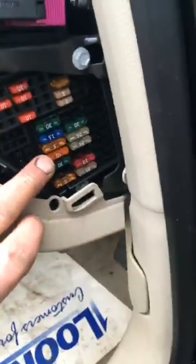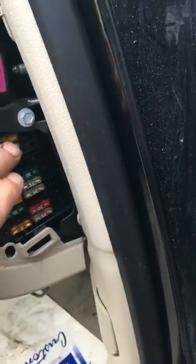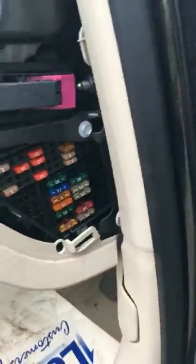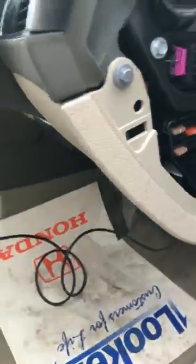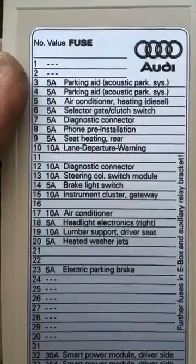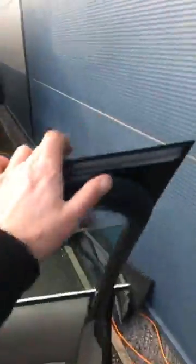I thought, let's check the fuses. I'd already checked the 40-amp fuse down here for the blower motor and that's fine. Going through the other fuses, I found a blown five-amp fuse. Sure enough, looking at the list, it's listed as the AC control fuse — five amp. I put that fuse back in and then on the black/yellow I've got a full steady 12 volts.